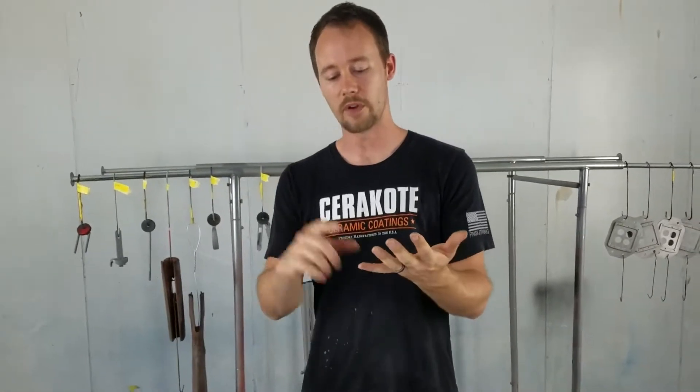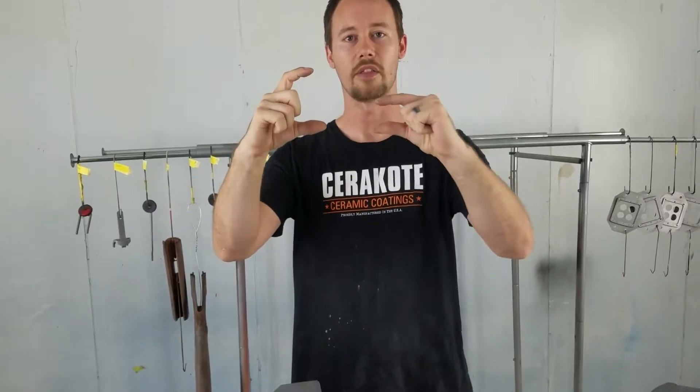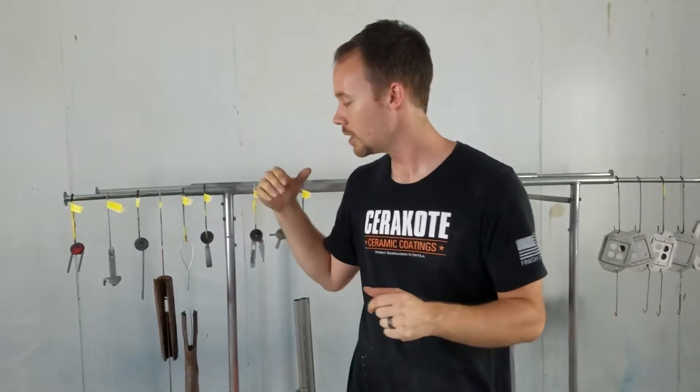So just to break it down into easy terms — you have a primer and you have a sealer. A primer lays on about this thick; a sealer may lay on this thick. The difference is that primers are normally a little bit thicker. Our direct to metal epoxy primer can be shot as a sealer or as a direct to metal epoxy primer. When you shoot it as a sealer, it makes it a lot thinner, but you can spray it on and then spray your base coat right over it — you don't have to sand it.